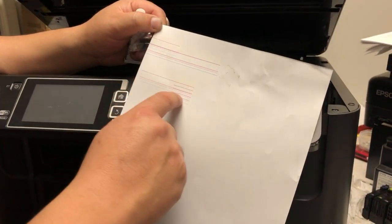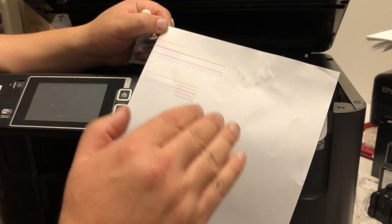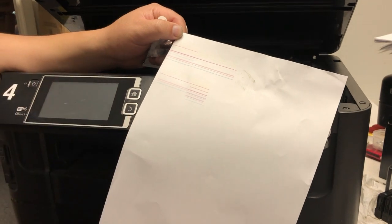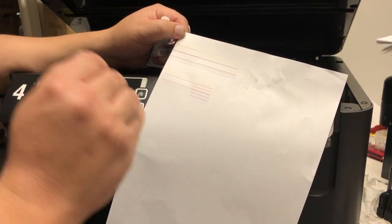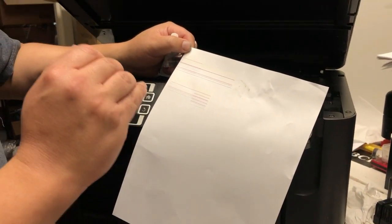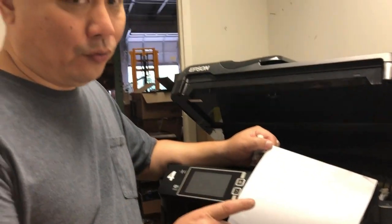So when you see this, stop right here, because you have an ink leak problem. You also have an electricity leak problem, because for the red to be powered on you have to have some electricity. There's electricity leaking from your power intake to the magenta port, and the ink has already corroded your print head and maybe your cable — you might need to repair both.